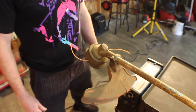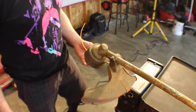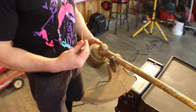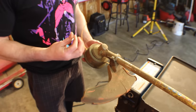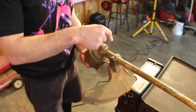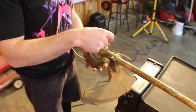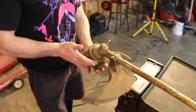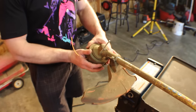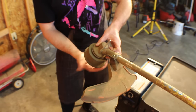Just for demonstration purposes I'm going to take my head off, and this is also what you would do if you were replacing the whole head. Your machine should have come with a pin like this one. If you don't have a pin handy, a screwdriver or anything will work — you want to stick it in the slot right there at the two points and that'll lock it in. From here, this is reverse threaded, so it is righty loosey, lefty tighty. Go ahead and thread it on off.